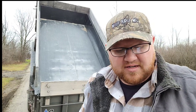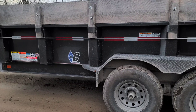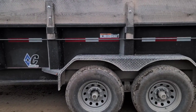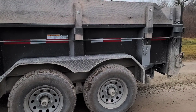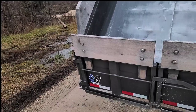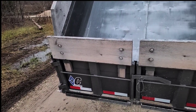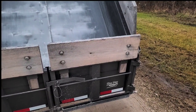Let's go over this trailer real quick. This is my 2021 Diamond C Low Pro Dump — this is what they call their heavy-duty model. 14 foot long, 82 inches wide. This has two 7,000 pound Lippert spring axles, electric brakes. Obviously this is the bumper pull model. This has the 8 inch by 10 pound frame, 5 by 2 rectangle tubes. This just has the 10 gauge floor — we'll get into that — it doesn't have the 7 gauge.